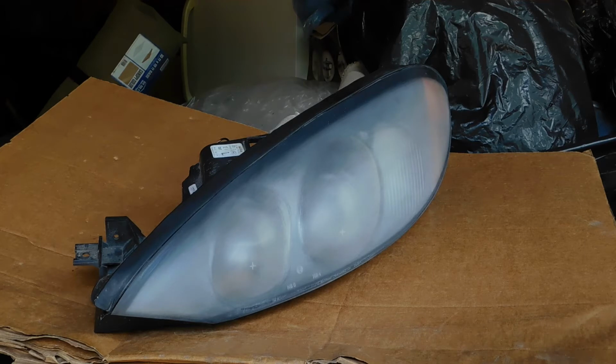The paint is ready. Now, one thing I learned about painting is that you want to start off of it and you want to end off of it. And I'm just going to throw on a few light coats. I'm probably going to throw on around 5 coats in total. Maybe 3 light ones and 2 heavier ones. Not too heavy, to where it doesn't get too much overspray, but just something that works a lot better.